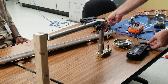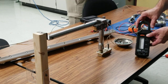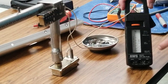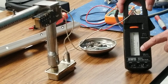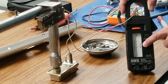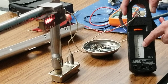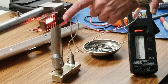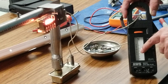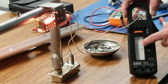I'm going to go ahead and turn this on so you guys can see this. You're going to start to see the igniter start to glow, and already the amperage is rising — it's at one amp, slowly increasing to two amps. Now we're just about three amps. Look how bright that thing's getting. We're about 3.3 to 3.4 amps. The igniter's glowing — that means it's going to be hot enough to light the gas. If I don't get that amperage and I'm right at three, that valve will never open.